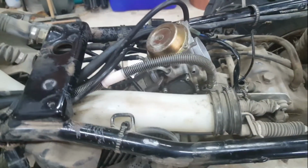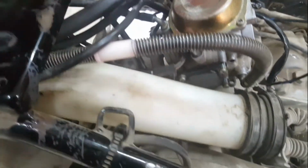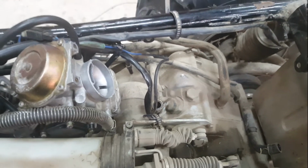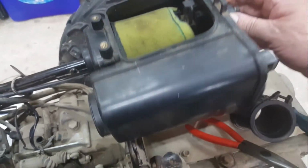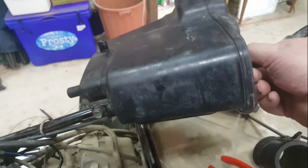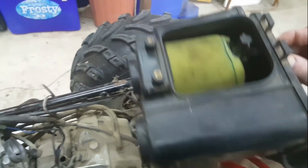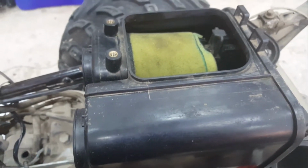So they're connected. Now I'm going to slot the front of the carburetor in to the intake pipe, then juggle the airbox and get it in place. The airbox is in good shape. I've given it a wipe down on the outside. Not particularly thoroughly, but that's the outside. I've had the air cleaner, the air filter itself, out and wiped around on the inside pretty well.